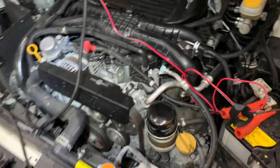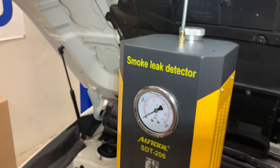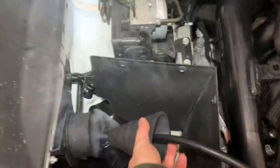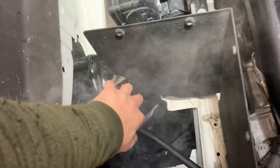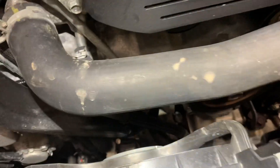Put it on the negative terminal. We use baby oil once we ran out of the oil that came with the machine. You get a nice steady stream of smoke, and you just take this and wedge it into the intake so that you get a pretty decent seal.